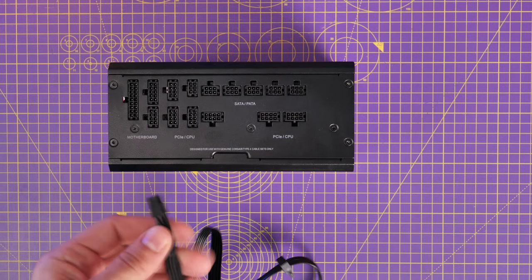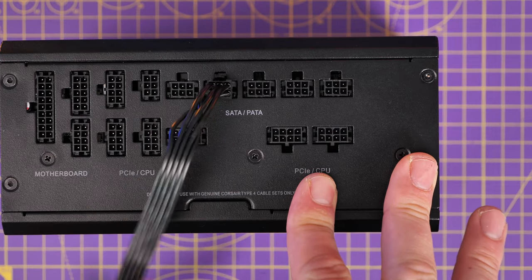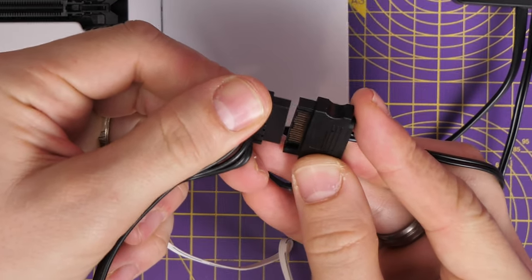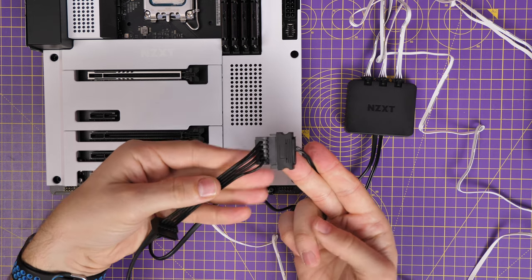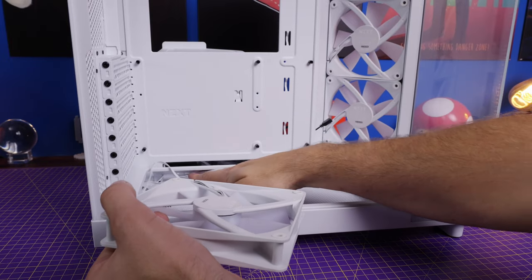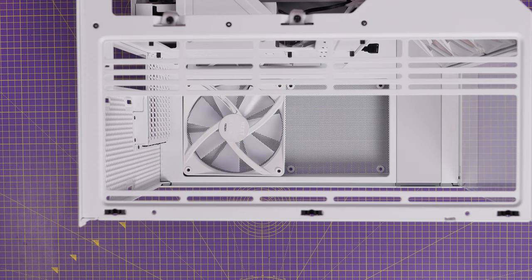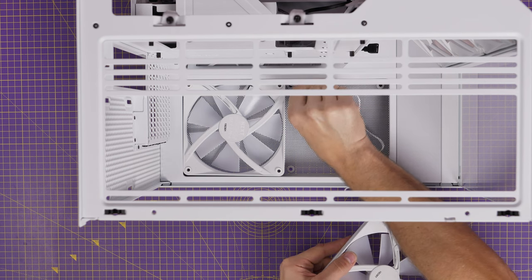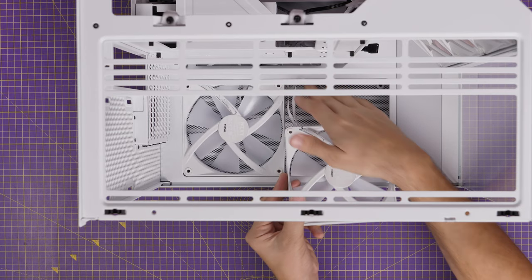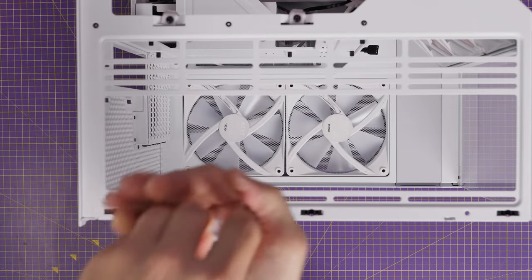The wiring for the Core fans is fairly logical, but you can see we've now got two different wiring logics for the fans. That's where this case falls down — NZXT doesn't supply an RGB controller or fan hub with the case, so you need to source that separately. That controller only controls three fans maximum, and the F140 box includes just two fans, so you have one spare connection. But you'd still need three connections for the three fans included in the case, meaning you need to source another controller anyway.